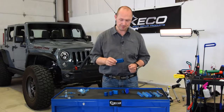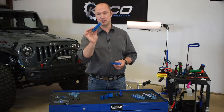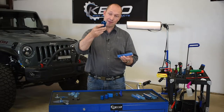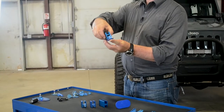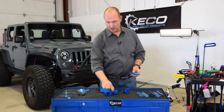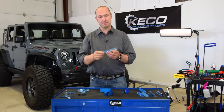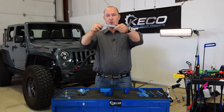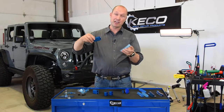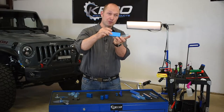So why these adapters? If it's a big dent and we use those bigger centipedes, of course we start as big as possible — because if you pull with the big adapter, the 100mm one, then you pull as straight as possible on those bigger centipedes. Why would you use the smaller 50mm one? Well, if it's a deep dent that slides into the dent and you want to glue it into the center of the dent, the big one might not be able to slide over it anymore because it's way too deep and it doesn't go over the tab when it's glued onto your car.